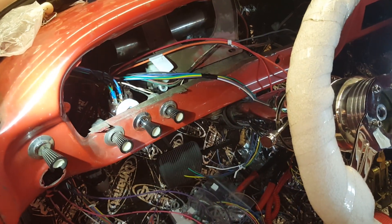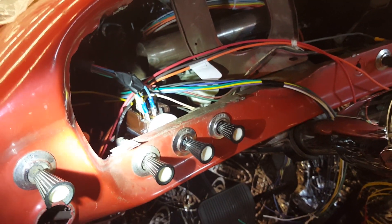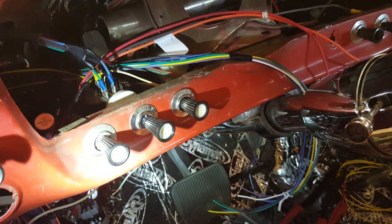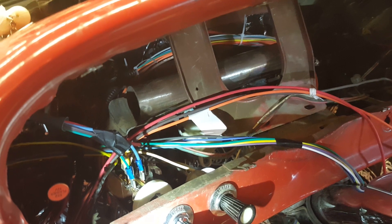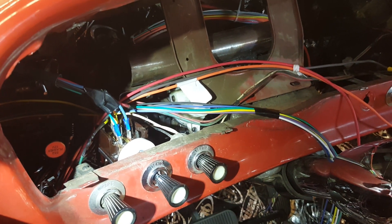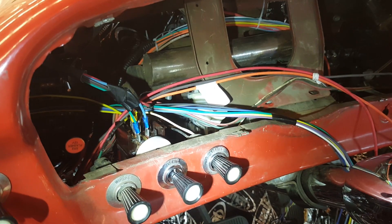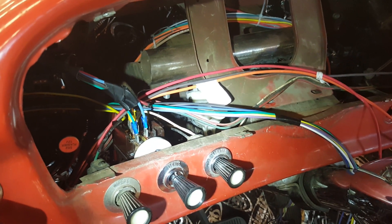Make sure you check the wiring on your truck if you don't know the history — that could have caused a fire and a lot of problems down the road. I'm glad we caught that early. Here we have the 1972 headlight switch in place, with the spacer tucked in behind, which pulls the switch back allowing you to use the stock bezel from the '64 truck. That switch lets me run the parking lights and headlights at the same time, and also got rid of the messed-up fuses with tin foil and jacked-up fuses from the previous owner. That fire hazard is now gone and this should be a lot safer going forward.